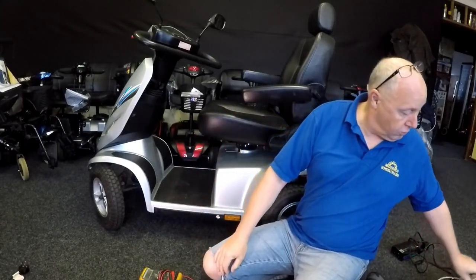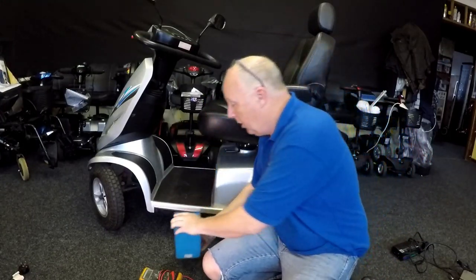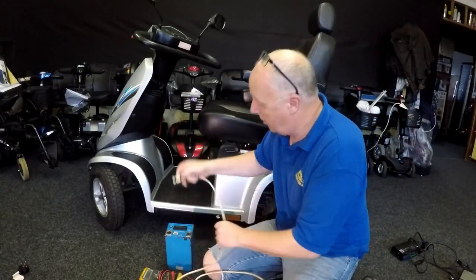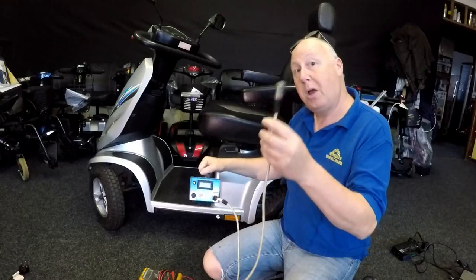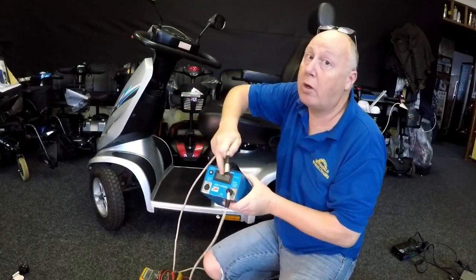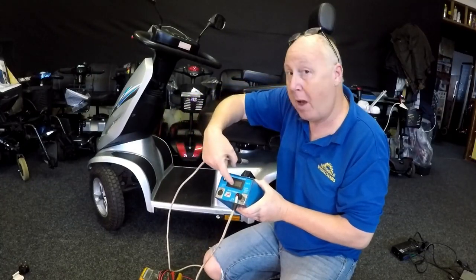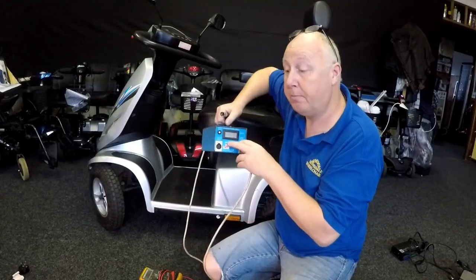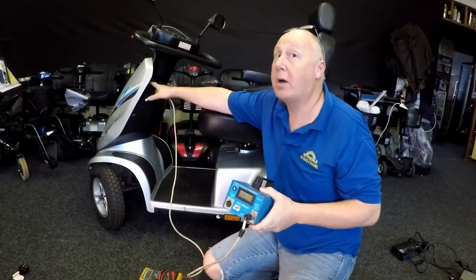I also use — which you most likely will not have — my battery tester. What I tend to do: I've got my charger in here, it's been through the wars, it's 10 years plus but it still looks fine. I plug it in there, plug that into the scooter, and straight away when I plug that in it will tell me if there's voltage yet. So it's a volt meter reading and an ammeter reading. Then I plug the charger in here, power goes through here, tells me how many amps it's putting in and the voltage at the same time. It also will test my charger. You most likely don't have this tool — it's an easy plug-in, and I know there's power coming.